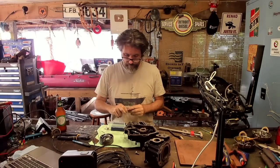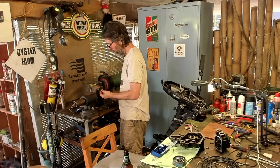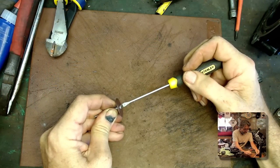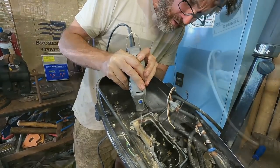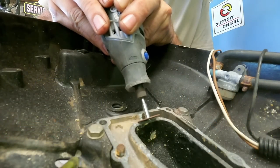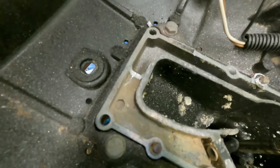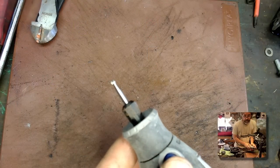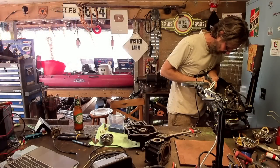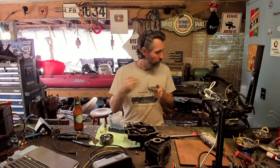I'm going to start with a little cutting disc — bit of an experiment. This is done up very tight, might put it in the vise. I think we got pretty much all of it out with the cutting disc. Might clean it up with the grinder, but definitely the bulk of it's out now. Let's swap it over to the little die grinder. So far so good. Now we have the raw water cooling the exhaust directly, and because we're blocking off the other holes, it'll come up to the bottom of here, just get pressure, go back, go out the exhaust — that's all it can do.